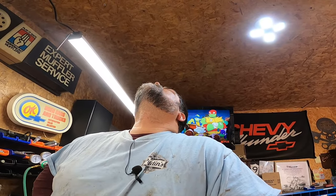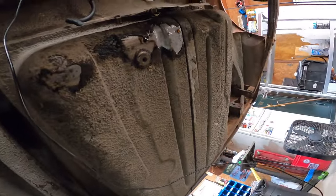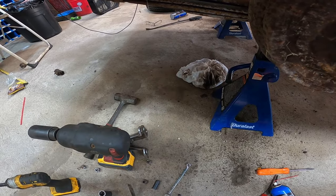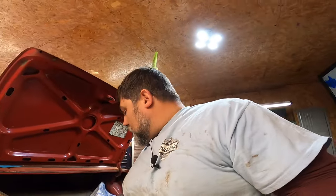I got news — all the brakes are bled, I got a good brake pedal now. She should be ready to drive. I spent all those hours cleaning this fuel tank and now the brake fitting must not be tight — it's dripping. Now the fuel tank's dripping right there — it's got a pinhole in it from the inside. So that's wonderful, it's depressing. I guess we'll deal with that — maybe run it until it's out of fuel and try a mickey mouse patch, because there are no replacement tanks unless I put a fuel cell in it. Fuel cells are the only choice I've got.